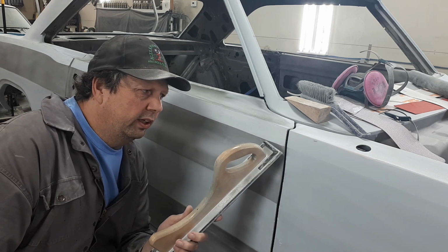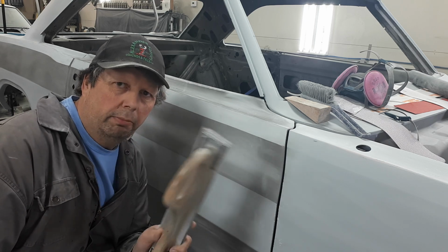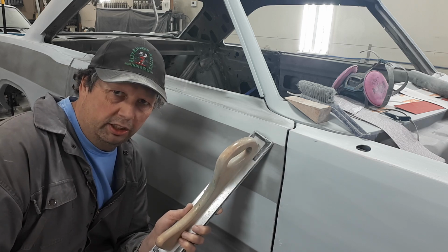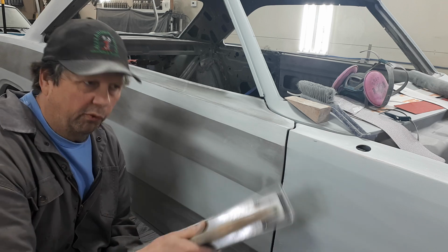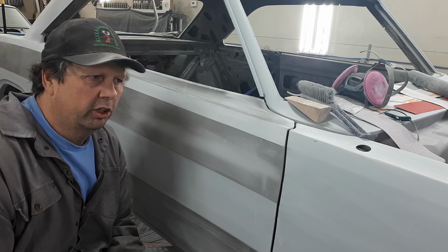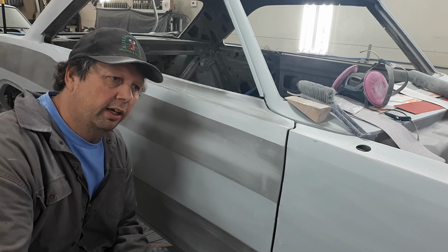And as far as moving these lines around with the 320, it's going to take a lot of scrubbing with that fine of a grit of paper to do any damage to any of these body lines. So as long as you got everything straight and tight before you blow the thing apart in 180 and you 320 it, you could damn near hand sand it. You can do whatever you want with your 320 because you should be straight enough.